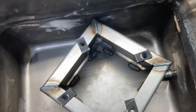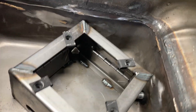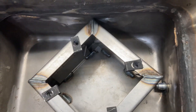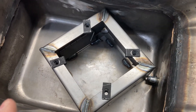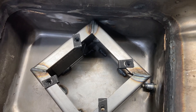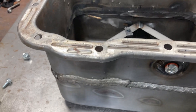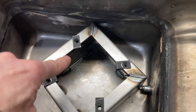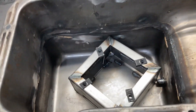The pickup will sit down inside, and these trap doors work to keep oil near the pickup during acceleration, deceleration, or cornering. I have these added to a lot of the factory-style pans I do. For example, the 352 'JJ' engine started with a factory short sump pan and I had all these oil control baffles added — something you can do to any factory pan.